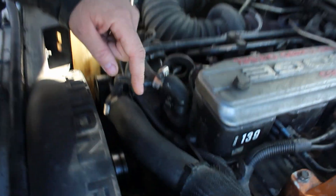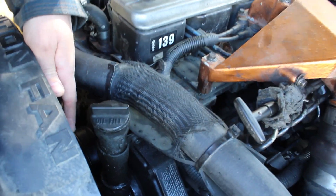So this is disgusting. What I'm going to do is take the timing cover off, put that dowel pin in, and try to take the fan shroud off too. The instructions say just to take the belt off, take this off, pull the crank pulley off, and then take the cover off.